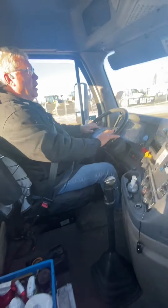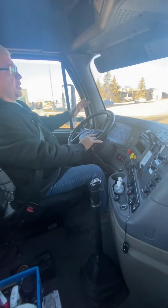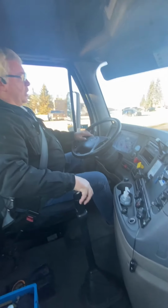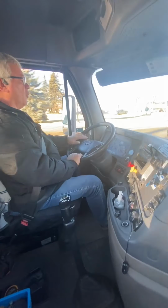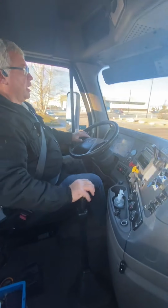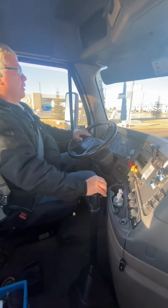So when it comes to downshifting, you want to make sure you're slowing down to 900 RPM in this case, because it's progressive shifting. Tap, rev up to 1400, put back into gear. Again, let the truck do a lot of the work for you on your higher gears. If you need to, you're going to use your clutch. Again, tap, bring your RPM up steady, and drop it into gear.